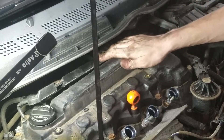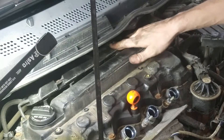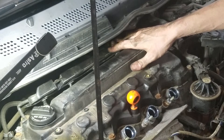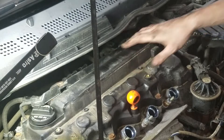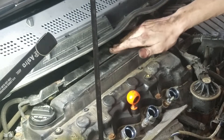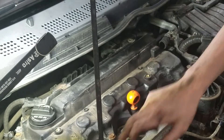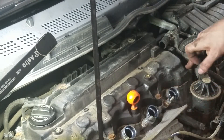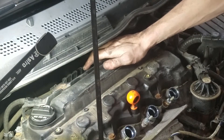This harness is loose — it's still connected to the four fuel injectors in the back, but I'm just going to push it back and get it out of my way when I set these valves. You can unplug the fuel injectors and undo this clip to buy yourself more room if you want it. There are four bolts here in the front of the valve cover and another four on the backside, all 10 millimeter as well.